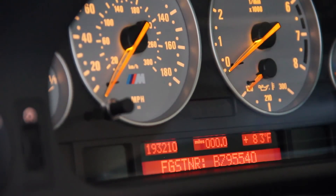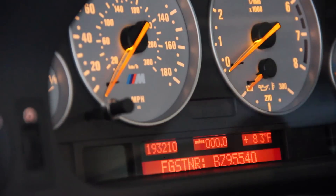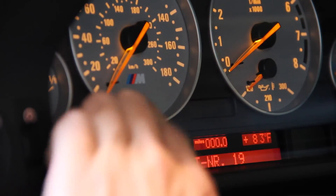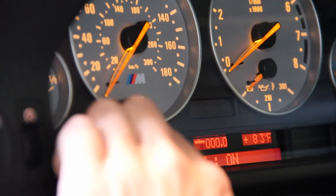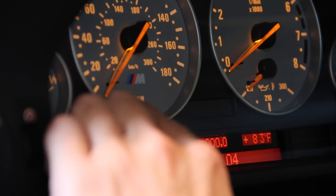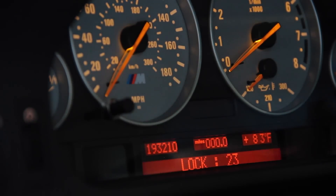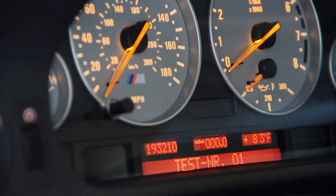For me it's the last 5. So we take the 9, the 5, the 5, the 4, and the 0 and add them together to get 23. Now we'll use the right pusher to navigate all the way to test number 19. Test number 19 is the lock function. Execute test number 19 by pressing the left pusher, then press the left again to enter the code of 23 — so we press it 23 times. The lock code is 23, and now we're back to test number 1, unlocked.